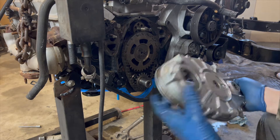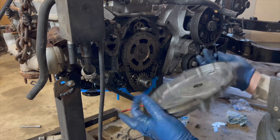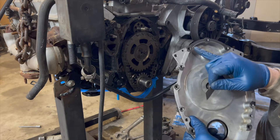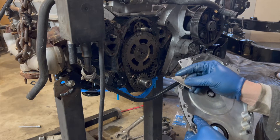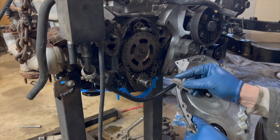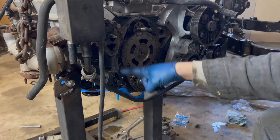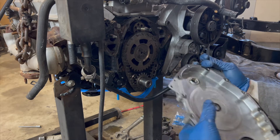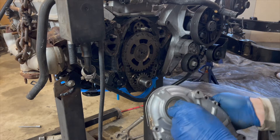What I'm doing now is pausing on putting in the oil pan gasket. I've got to take the gasket off lightly with a razor — just scrape it very lightly, not to take any aluminum with me. I've got to do the face, then I can get a flush fitting. And then I've got to remove these seals.